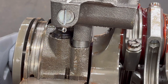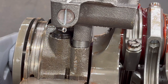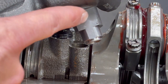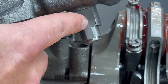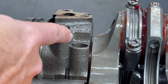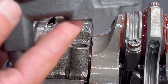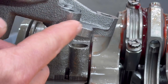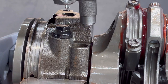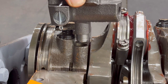So basically what you do — it's quite simple. If you either have a die grinder or a Dremel tool, all you're going to do is take this oil pump and work in this area here. You're going to groove that out just however much you need to. Do a little at a time and clean that up — it's very solid, but that will clearance it so it slips on down in there and sits at the right angle and seats properly. Mind you, these are cast units on these oil pumps, so when you're actually tightening these down, you do want to be careful — you don't want to force it because you can break this casting. So in order to work with a small block Chrysler, especially on these 5.2 Magnums, to get the oil pump to actually seat properly, you do have to clearance these if using ARP hardware.